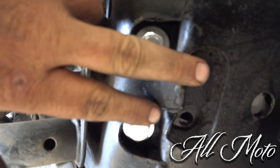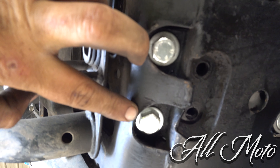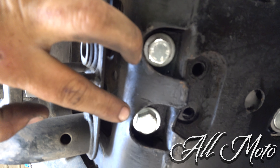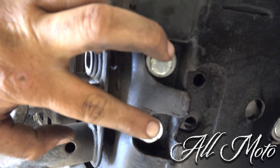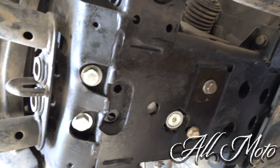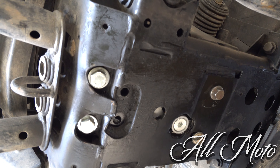On the front, instead of using these two bolt holes, now it uses these two. The holes were already there, I just had to make them bigger. These go through here and through the three-quarter steel plate and then into the differential — they are a little bit longer than the stock ones, obviously. That's some bare metal, so I'll spray it down with some paint to keep it from rusting. I'm going to go start working on the winch mount and see what I got to do to get it to work.